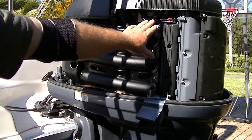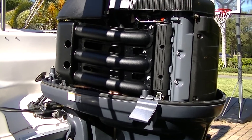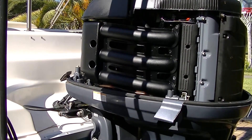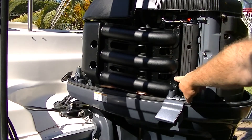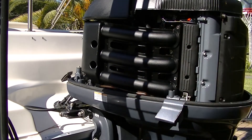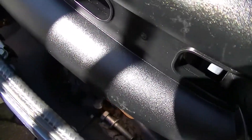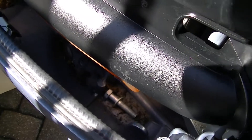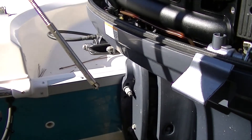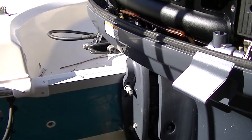The first piece we're going to take off is this intake manifold — looks like 12 millimeter bolts. We have three bolts to remove: one, two, and three, plus one down below. We're going to use a universal swivel to get at that. I did drop a bolt right down there — I used a retrieval tool that operates with a spring, and the top opens up a claw. I've used this tool many times with cars, boats, and even clearing hair out of drains.